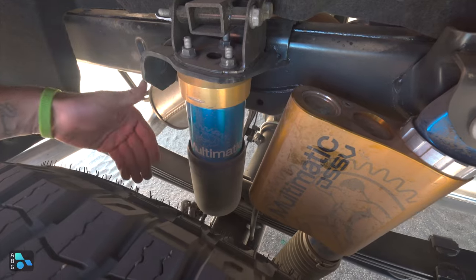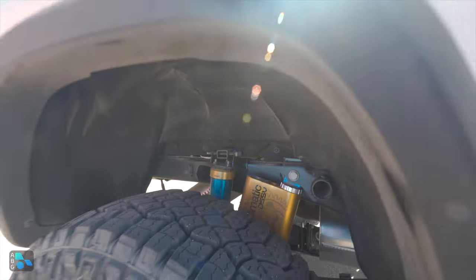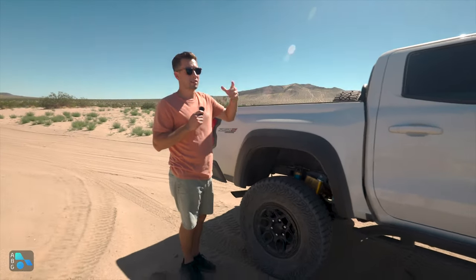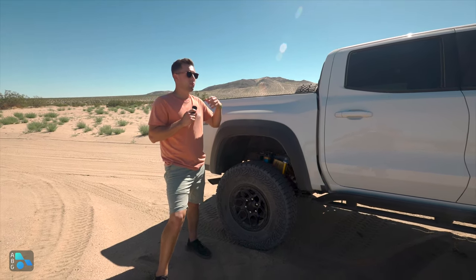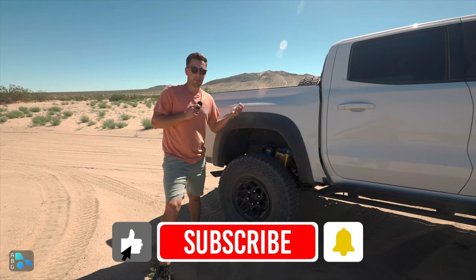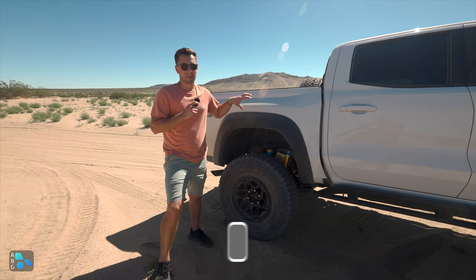And so when the suspension is at full compression, that actually gives you a little bit of stiffer compression at the end of your stroke to make it so your car isn't bottoming out as hard. So that is special to the AEV. They get those jounce shocks that help when you are under full compression. That is a one up over the normal ZR2. So if you want just a little bit more off-road capability, the Bison is going to give you that in the suspension department.